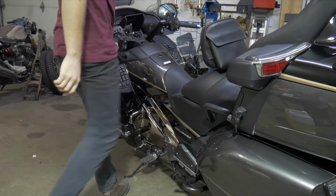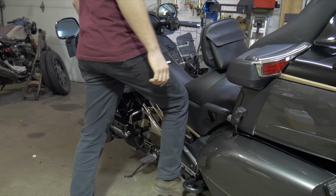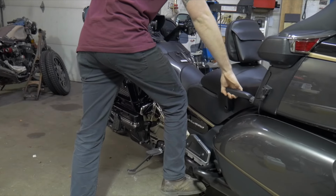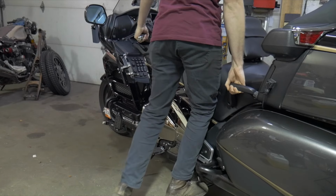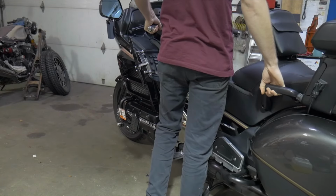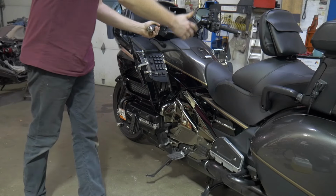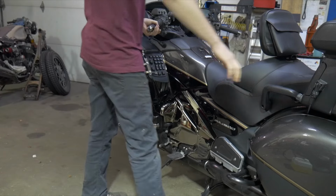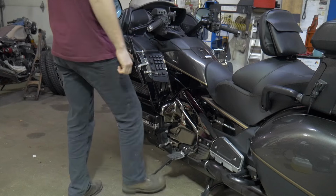Okay, let's go back up again. Foot's down. Get up underneath it so I can lift this bike into the center position. Find those 2 feet, and it'll just kind of sit right there. Come down and up back here. Okay, now to come back off, let's say we don't want to get on here. This is a little bit more strategic technique. But we can actually roll the bike off the center stand, making sure this is down.